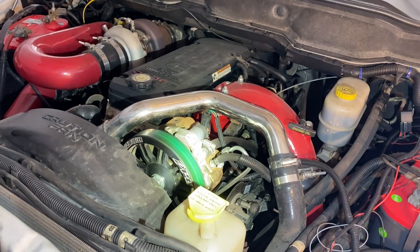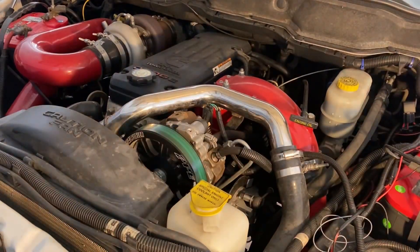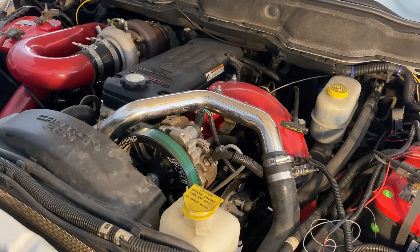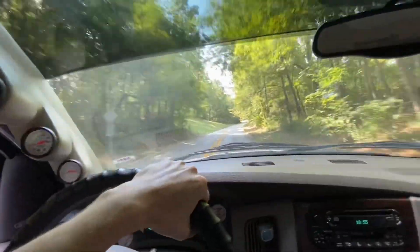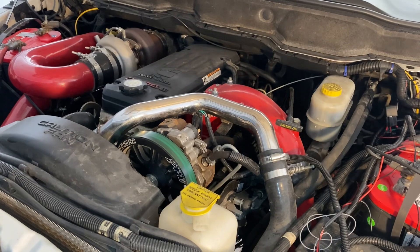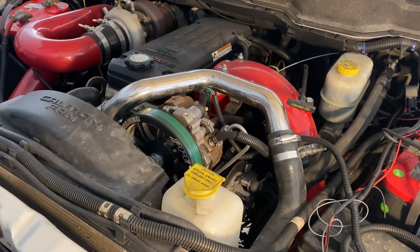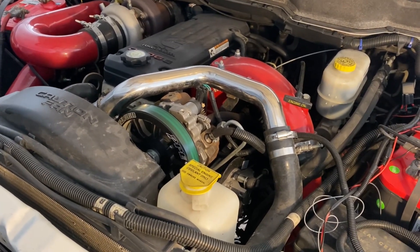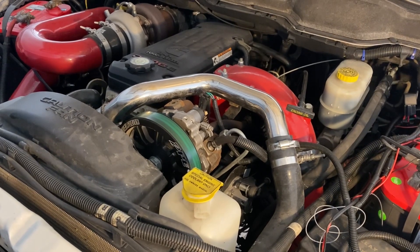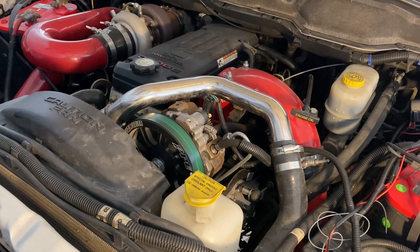Regarding the functionality, I've had this kit on here for probably about 10,000 miles. The only issue is this is on a Cummins, and I believe it's a Duramax pump. When I put this kit on, I noticed there was some fuel surging. I think the surging is due to the fuel control actuator on this pump. If you swap it out for a Cummins fuel control actuator, it will get rid of that surging. However, I just got my truck tuned this week with NM3 tuning, and the surging went away. So I'm not planning to replace the FCA, but if you have this kit and you've got surging, you might need to swap out the FCA for a Cummins FCA.